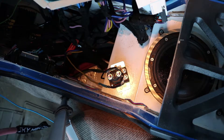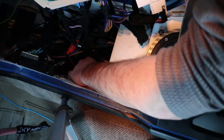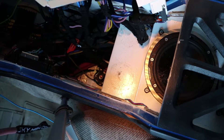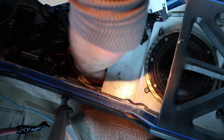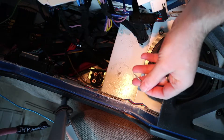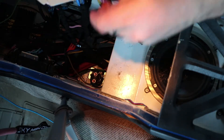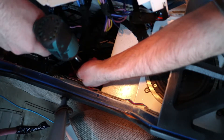You do want these units mounted somewhere stable — mine is inside the car so it's very stable. But if you're mounting in the engine bay, like I had it with some self-tappers through the firewall, I would recommend that wherever you mount it, you sand down the paint first. The bottom of this unit is also a ground, although it's not necessary or required. That's why it's all metal on these Pack 80s. Now lining back up the holes and taking my screws.